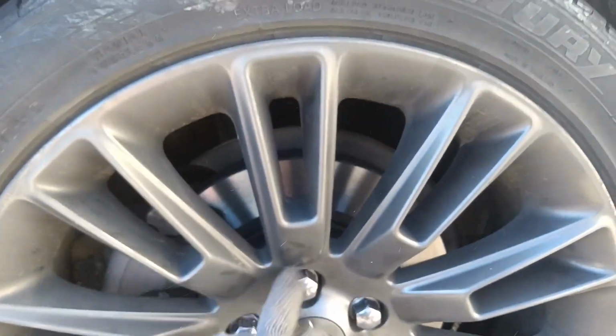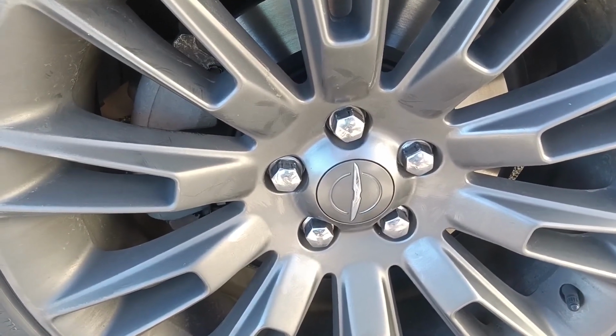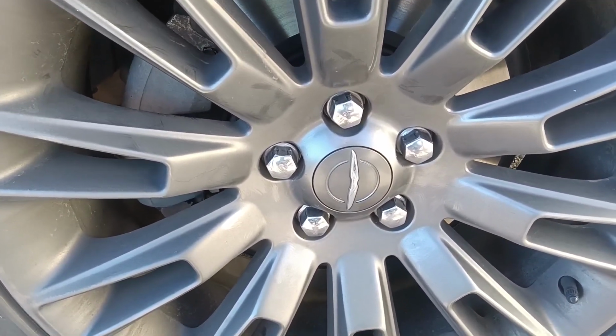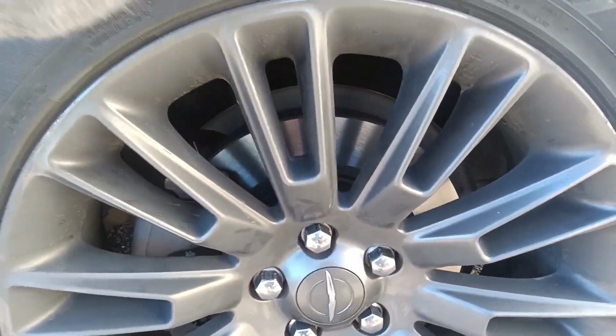Post test drive, we got ourselves a happy car, and as you can see, the coating rubs off of the rotor except for the rest of it. But that's going to look nice and pretty in there, be corrosion resistant. Folks, I hate them lug nuts. I had to come back and make an adjustment on that. Them suck. I'm going to recommend a replacement of all of them, and we might just go with acorns or some spikes, something without this chrome cover on it. But that's all good. This car's stopping quiet and smooth like it should.